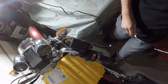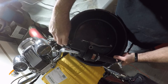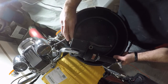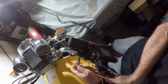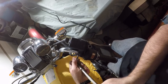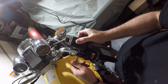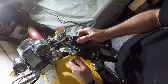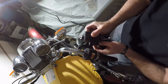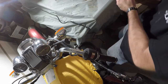And I should have something underneath it to catch any liquid. These are 5mm Allens. You want to make sure that you get a replacement with the same size piston assembly as what the original has, since this is a dual front brake.